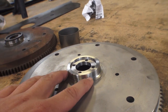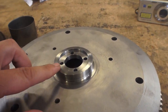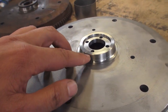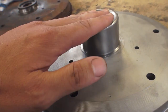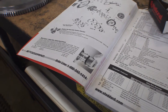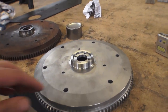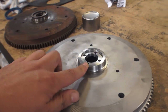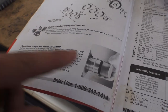It's tight enough to the point where it's not going to slide off. We do recommend maybe getting some sealer to go on the neck, like a Loctite or something — you can put it on the inside of the sleeve before you hammer it down. It just hammers down like this. I called Stoddard up to see if they have the sleeve for Volkswagens and they really didn't know the measurements for the Volkswagen. I did a little homework online through the Samba forums and found out that the sleeves for the early 356 Porsches are the same for the early Beetles, so you should be okay using the sleeve from the Stoddard book.